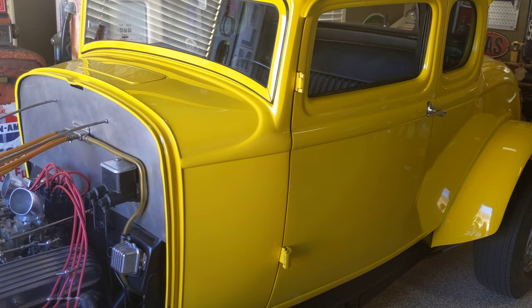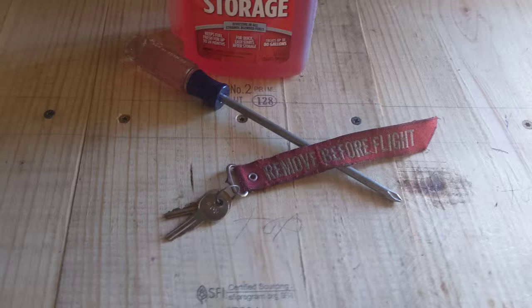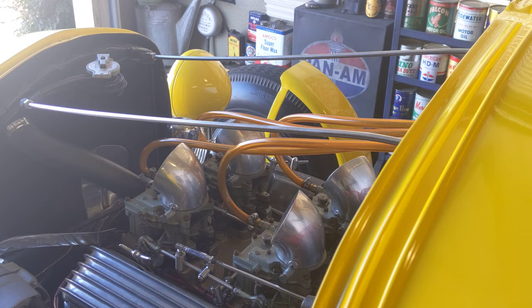Let's take a look at things and start from the beginning. This is going to be a true cold start — the car has sat here for over a month. I've got my keys here, we talked about the process in the previous video. I'm going to come over here, pop that door, make sure the car is in neutral, stick my key in, turn the key on, and we're going to fill the lines up with gasoline using that long lever at the bottom.